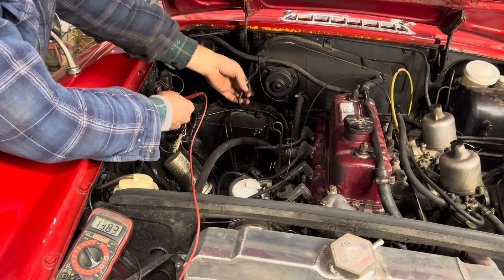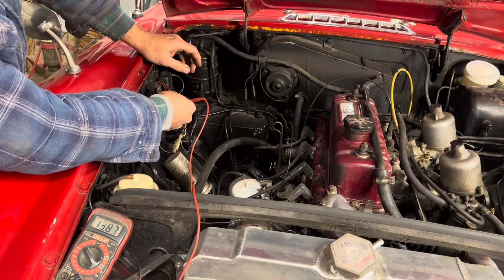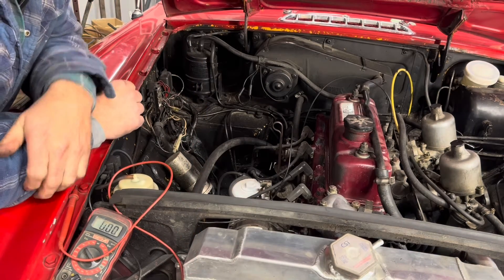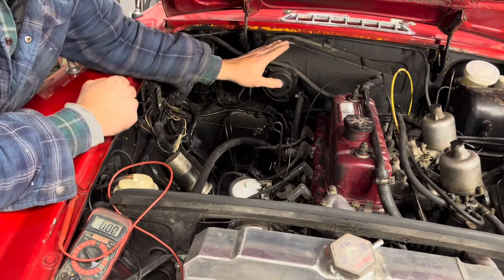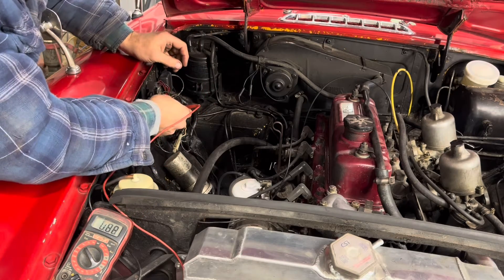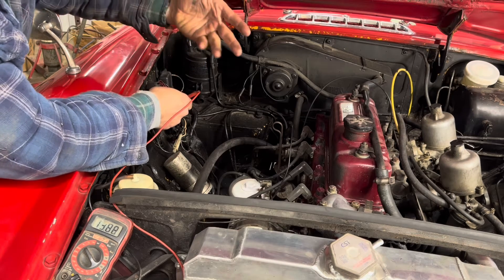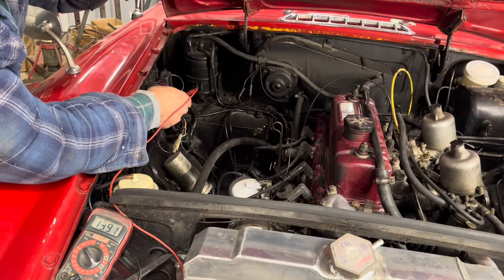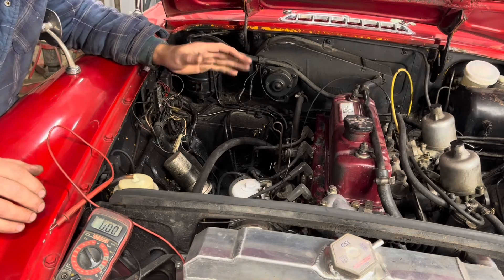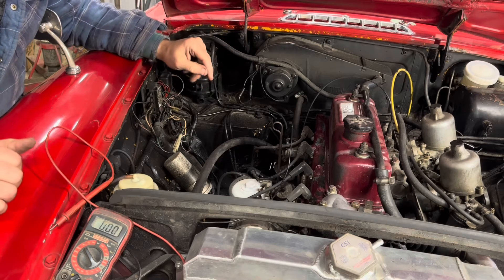The blower motor is not working — we're having a bit of technical difficulties. It appears the motor doesn't even work on this thing. But we are seeing voltages above idle staying where we want to be. At really low idle it drops below, so we're actually not looking too bad. This thing might have a slight drain in it somewhere, which could be a relay sticking or all kinds of things causing that. That's a much more in-depth video to get into.